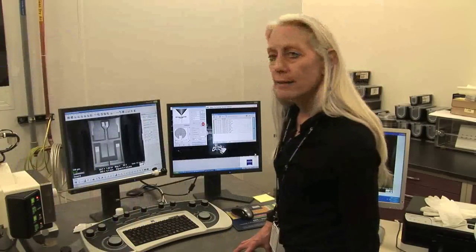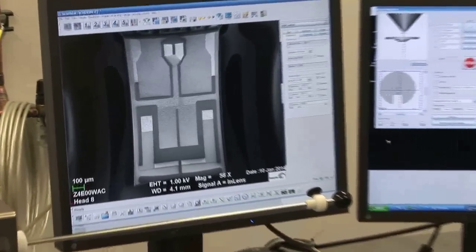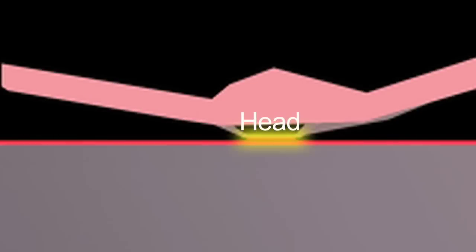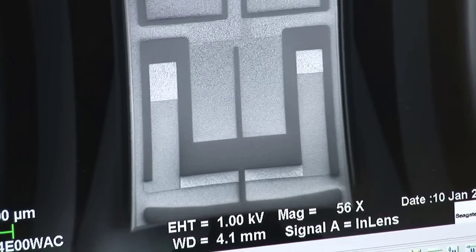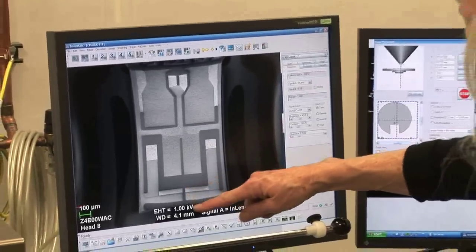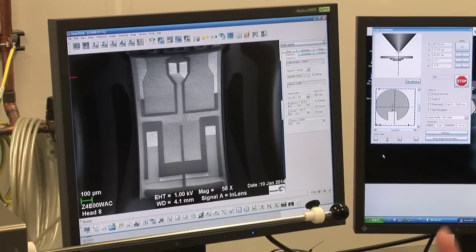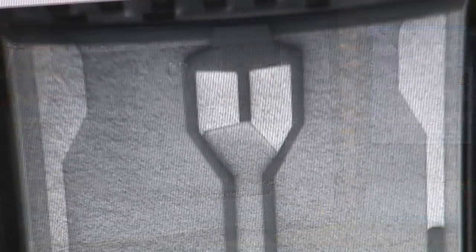What we are looking at right now is the surface on the recording head that's facing the media surface. So the disk is spinning under the head, and there's an airflow or shear between this air-bearing surface and the media surface. These darker areas are in relief outward, and the medium range is actually inward. And these surfaces in relief are functioning in the way that we would think of wings or the features on a jet that control the flow of air.